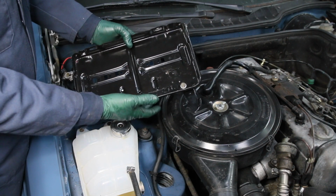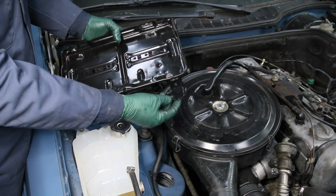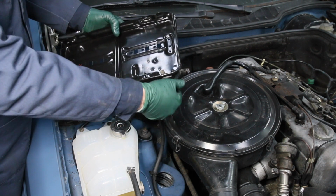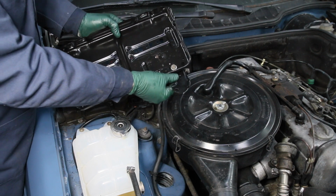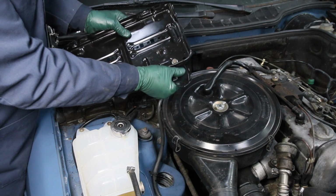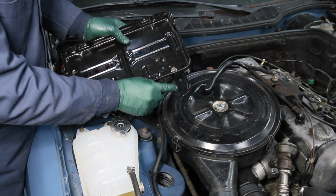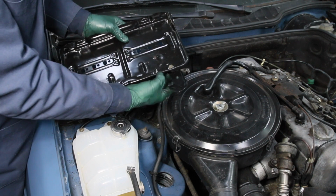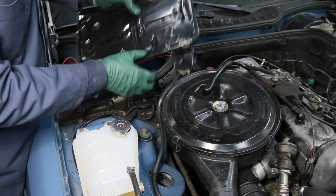Well, I've completed the modification. You can see I took the W126 bracket off that other rusty tray and put it on here. It's held on with one bolt, which is adequate, but this will allow me to adjust this, pull it in and out and move it back and forth to get the alignment on this hole just perfect, and then I can tighten that bolt down. That's more than strong enough. And I'm using a big washer on both sides.